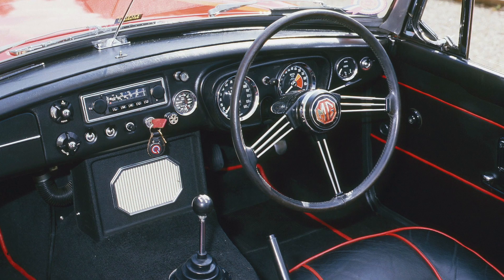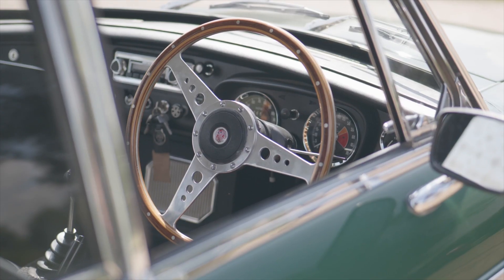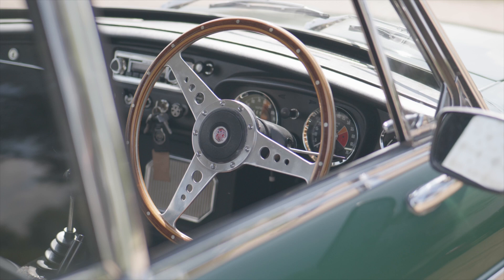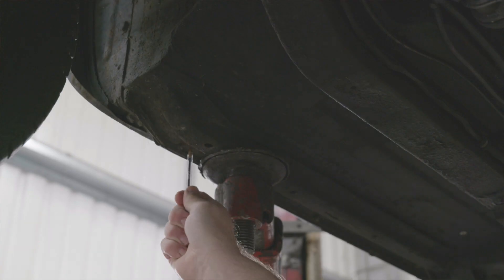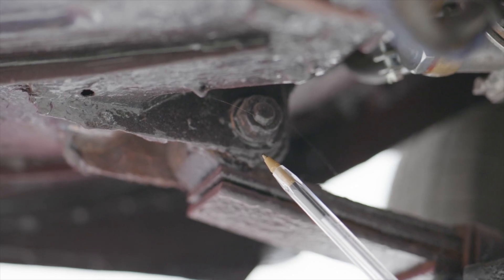You also need to check if it's an original steering wheel, which is leather bound — thin leather bound. If it's a replacement wheel, ask the vendor if the original wheel is included. They're a rare piece of equipment. When looking at an MGC, you've got to look at very similar areas to the MGB: the sills, the floors, the suspension pickup points. Corrosion is your enemy.